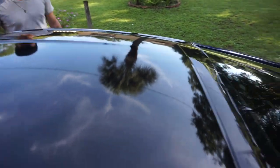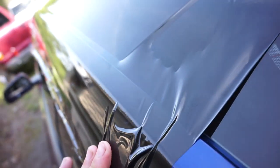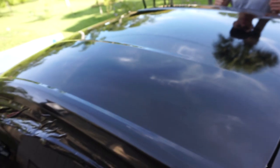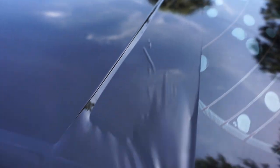The roof is wrapped now — I just have to cut the extra vinyl. What I did is cut to the glasses right here, cutting right on the edge of the glass. I'm gonna give it a nice seam cut — I'd use knifeless tape but I couldn't find any, so I'll do my best to get a nice straight line. Just glass out your vinyl wrap, lay it, squeegee it out. You can get a vinyl wrap kit on Amazon — really all you need is a squeegee and a blade.